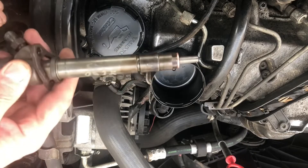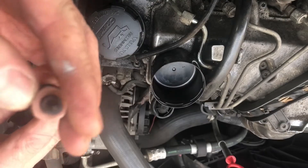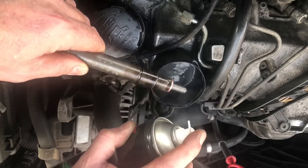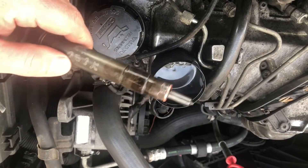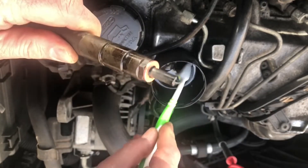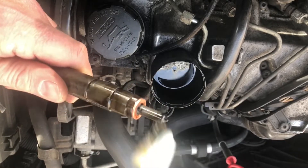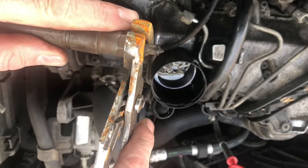Let's get on with the cleanup — we've got this injector tip to clean up and there is a bit of gunge there. The injector seal is gunged on so we'll just give it a squirt of carburettor cleaner and give it a little bath. I've got the surplus being collected in the cap — I have a purpose for that in mind. I've got an old toothbrush reserved for this purpose. I don't want to use anything metallic on these injectors — in the tip there are a few holes where the diesel squirts out, so nothing metallic whatsoever.